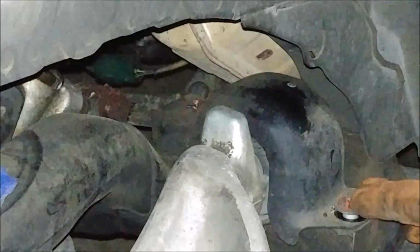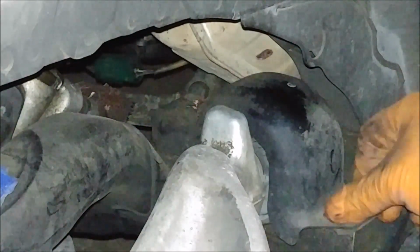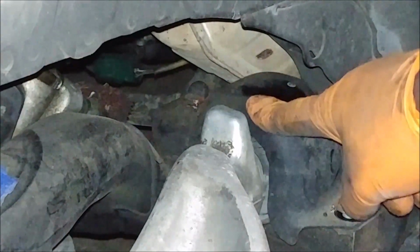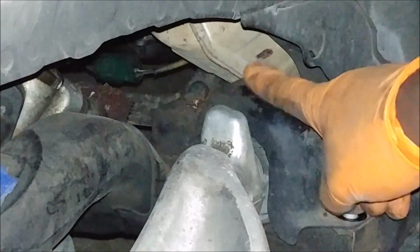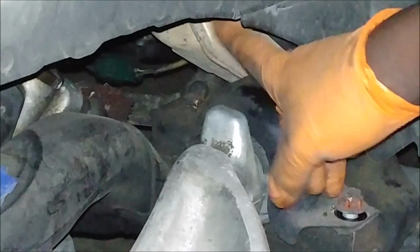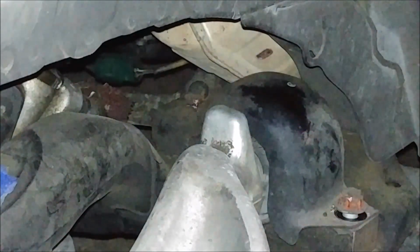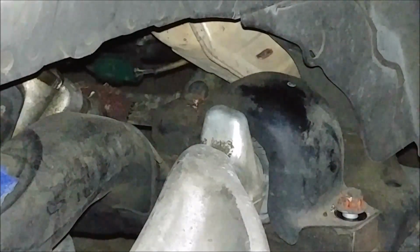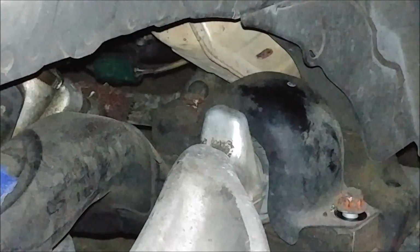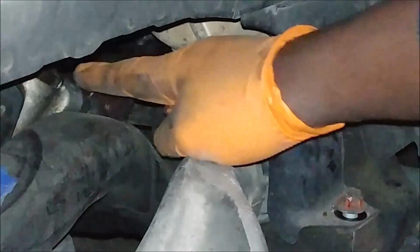So sometimes there's a complication, right? This is the exterior one. This one's the one that's more accessible. You can see it. The other one, you can see it there. But then the catch is when you're doing a V8, see this whiteness, this light material? That's the catalytic converter. It's right there, right on top of it. So you have to have a pretty good selection of tools to be able to get there. I tried my breaker bar. It was too tall. It was banging against it. You can't really use much else because you know what's right here?